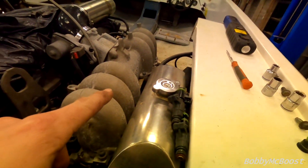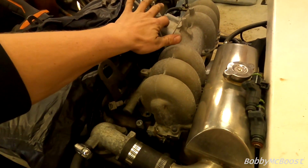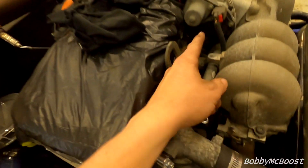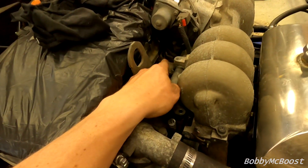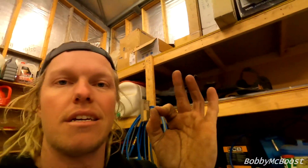Just changing the injectors to 1000cc. You don't have to pull the throttle body out of a B-series to get the rail and everything out. I've got five injectors — the last one's the hardest but you can pretty well push out the injector, leave it on the plug, and get it to a position in this area to change it. You only need to take off the four bolts holding the fuel rail. Much easier and faster.